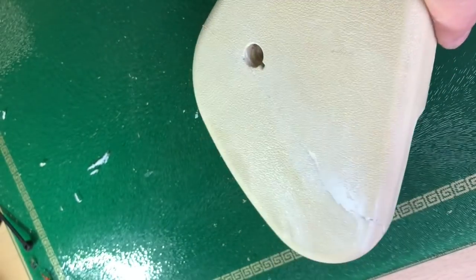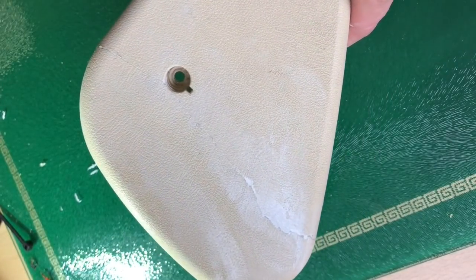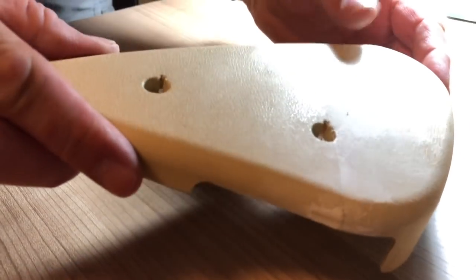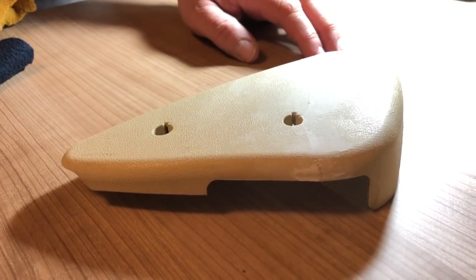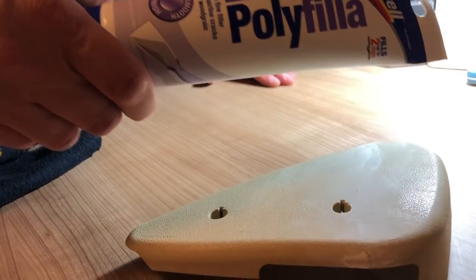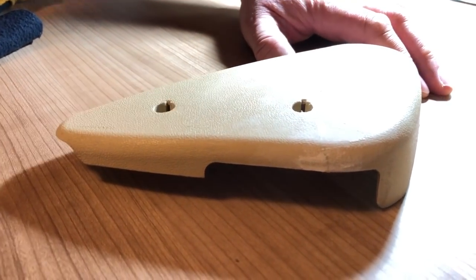Way less than perfect, but we are talking about one piece of plastic now. So, wish I'd never glued it. I could have got this right perfect. Look at that. So we finished putting some filler on this. We've got it all stitched together. And as I said previously, I used polyfiller, which is not a traditional choice for car stuff, but it has an advantage, which is I could wash it off of the grain, and also it's absorbent.